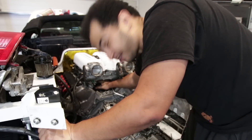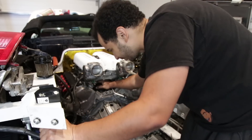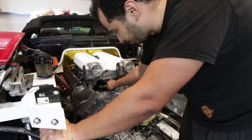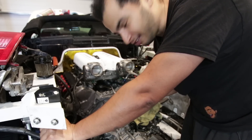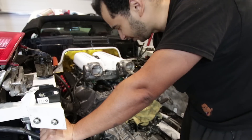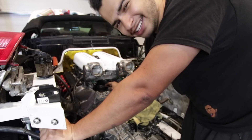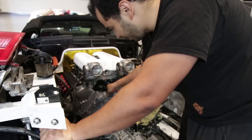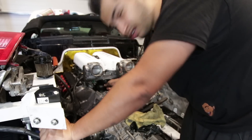Since I already drained the old oil, our oil change is essentially complete — though some old oil will come out of the drain plug when I take it off to plumb the turbos. In a regular wet sump engine, you'd have to plumb the turbo drain line into somewhere above the oil level on the pan. On this car, you put it into the drain plug itself because there's actually suction coming from there — that's where the oil pump gets the oil from. It's pretty ingenious, and a lot of people have been running it like this, so I'm not going to reinvent the wheel.